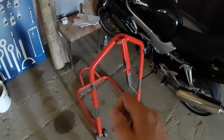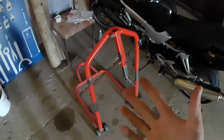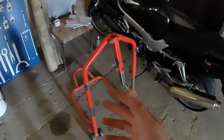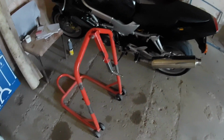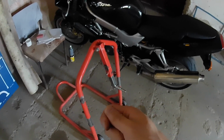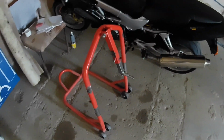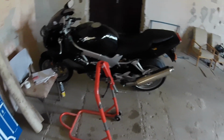I have the welder on the hottest setting. I have the wire on. There is a 10 scale wheel, so I have it on like 5 or 6. So I think I have it pretty hot, but the weld doesn't stick. So let it be the warning for all of you.